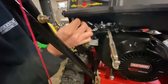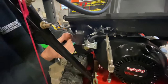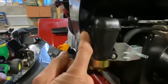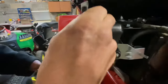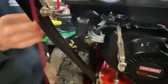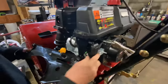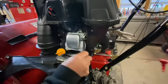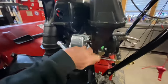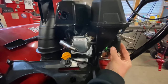Now the fuel primer line is actually connected to the cover here. It has a little teeny bracket in there — you can just pull that out. The other thing is this actually has a vent hose connected to it, so you want to pull the spark plug wire off and out of the way. Then you have a clip here — you can use a pair of pliers, though this one came out pretty easily. I usually try to leave the clip on this side and push it through the hole, and then this piece comes out with it.